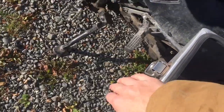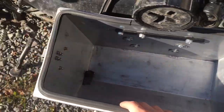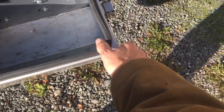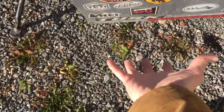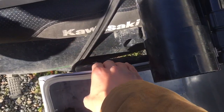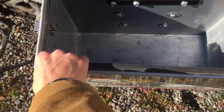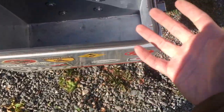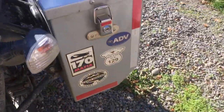One thing that will happen if you crash on the front of them is they'll crack here — I've hit the front and bent it back from its racked position and it cracks out. Obviously the seal isn't watertight there anymore. Also, when you go down on the side, you're putting half the weight of the bike onto a sheet of aluminum, so this gets bent outward. The rack will push into the box and you can try to pop it back out, but doing so loosens the box and introduces some play.